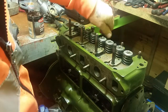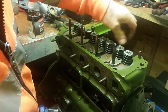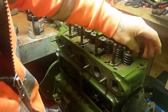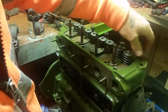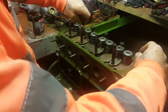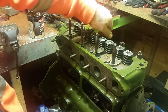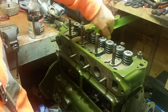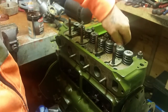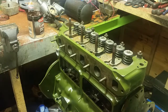All we've got to do now is put our nuts on this side of the engine - we can't do the other side simply because we haven't put our rocker gear on yet. You'll find that when you've done the copper grease, your head bolt nuts will all slide on very easily, you're not straining with anything. Put them on finger tight - they'll all just fit on nice and easy. I'm going to repaint and clean them up when we finish the engine off. So that's that side done. I'm going to pause the video and then show you about the rockers and the push rods.